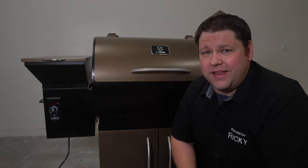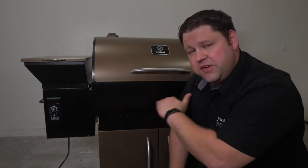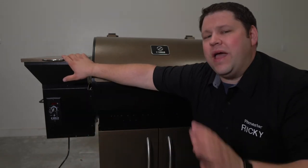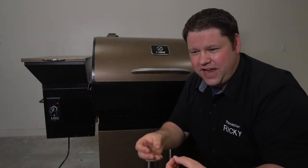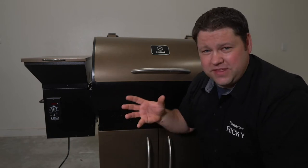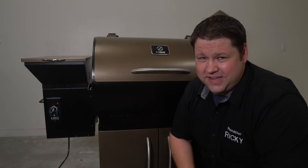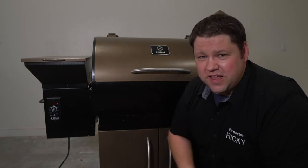The reason for that is that the augers can jam up pretty bad if there are a bunch of pellets down in there that have gotten damp. Wetness makes pellets swell and kind of revert back into sawdust. And if they stay damp and they swell, they can just lock everything up. So if you want to prevent auger jams, which can be a pain to take care of, it's good to empty the pellets out of your smoker in between sessions — again, if it's going to be more than just a few days.